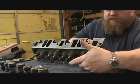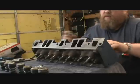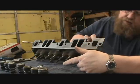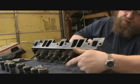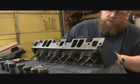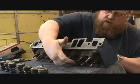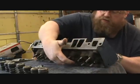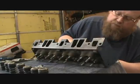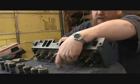I even spin the valve around a few times to make sure that oil gets worked in there good, because the last thing you want to do is chew up your guides. I'm just putting a little squirt in there, get it in there, and spin the valve around as I push it through. I smoke a little when I start it.